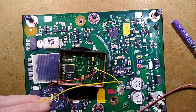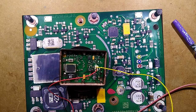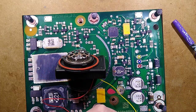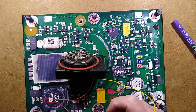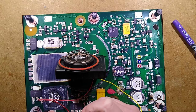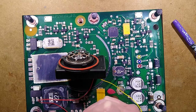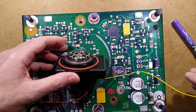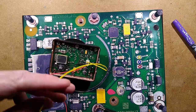Current is on. It drew a brief spell of 50 milliamps and then went down really low. Dabbing the wire on the positive connection gets no response — it is not being fooled. No current is happening. Basically, it says: you're not a real BMW ECM, you're just someone poking a wire on.